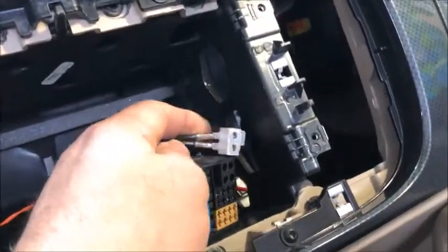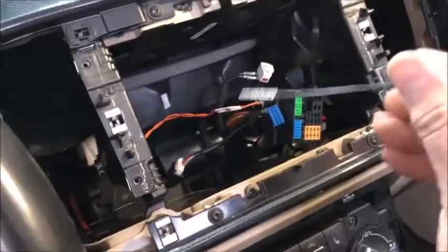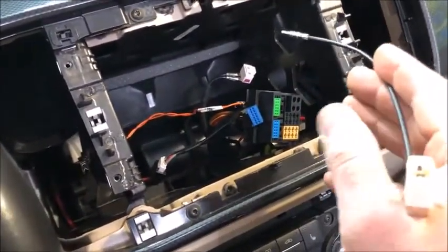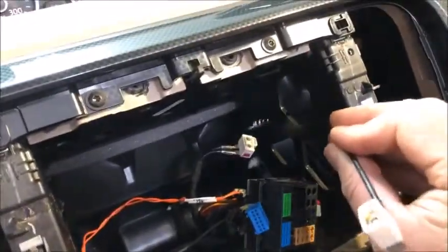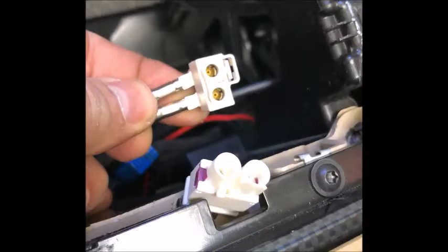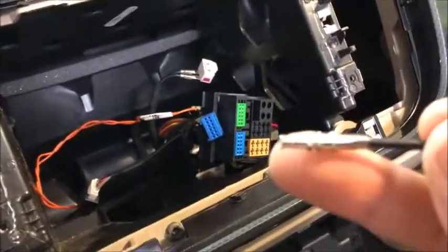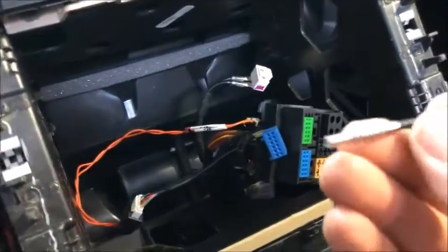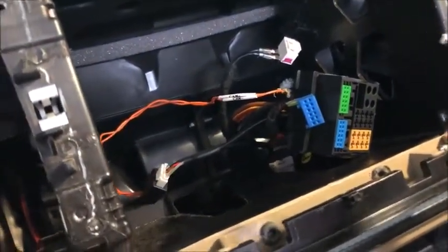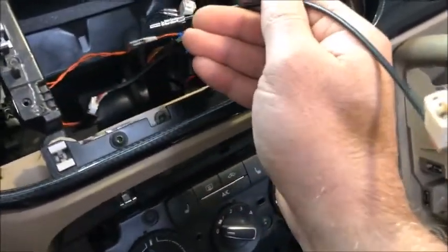This is the original antenna, which is part of the problem. These cars have two antennas, but this unit only uses a single antenna. It comes with a cable that lets you tap into one of the two antennas. Do not use both — that is a misnomer; combining them does not give better reception, and they have a good write-up about that. You have to pick the one with the best signal. The connector that came with this was the wrong housing, so it doesn't hold in — I took the jack out and plugged it directly in. Right now I'm only getting three stations, hopefully that improves outside the garage.